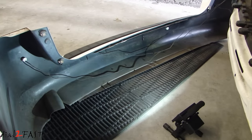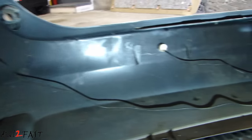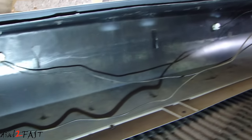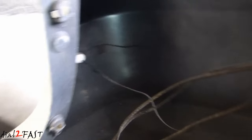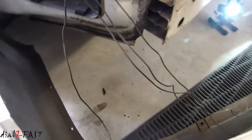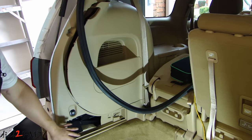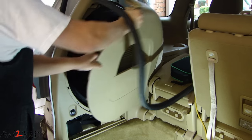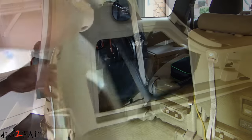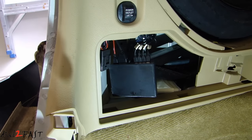So let me show you the sensors looking at it from the inside of the bumper. You'll see the wiring running over to the driver's side, and it goes into this grommet right here. Go ahead and remove the cover for the jack and also the cover for the spare tire. Here's where I installed the parking sensor module. I'm going to go ahead and remove all the old parts and then proceed to install the new parts.